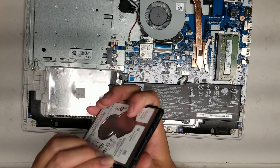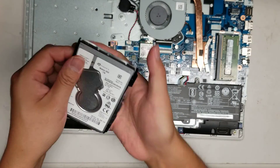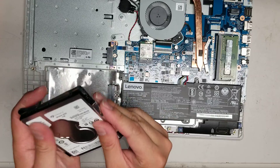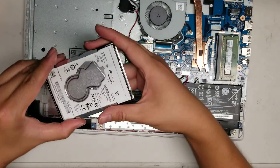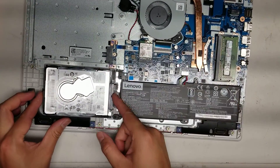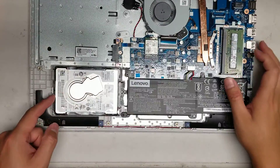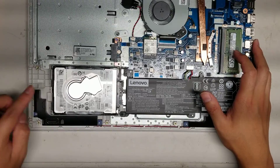You can actually put an SSD in it. You just pull these plastic pieces to the side and then you can take this tray off and put it on a new hard drive. I'm not going to take it out completely because I don't need to — I'm just showing what's inside. Put the hard drive back in place. Try and keep some pressure here — you don't want to let these little plastic pieces do all the work because sometimes it can break. Make sure to push this in and get that little lever back underneath this plastic piece.